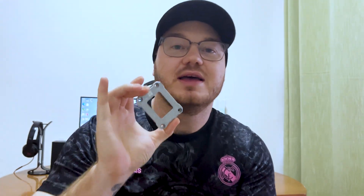Hey, it's Daniel and today we're going to be looking at this little guy over here. This is a bracket designed to replace the ILM that your motherboard supplies for the new 12th gen CPUs. As you can see, the new CPUs are quite long, so one of the issues they've been facing is good contact for your heatsink. Because they're so long, the ILM as designed has only a little pressure point on the side, so it doesn't really make perfect contact. Companies like Thermal Right and Thermal Grizzly have made this bracket to address that.